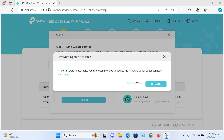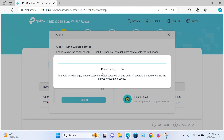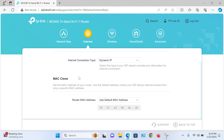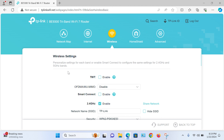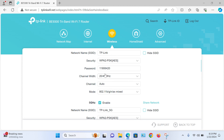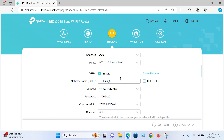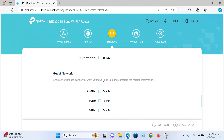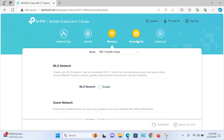Setup is a very easy three-step process. Download the TP-Link app to your Android or iOS device, connect your router to your modem — or if you have Fios with Ethernet, connect the WAN port directly and skip the modem — then follow the in-app instructions. There are tons of settings available, and you can also use TP-Link's web-based configuration. It's a gamers' and professionals' dream, and also allows parents to use parental controls, keep an eye on kids, and block malware websites with built-in security.